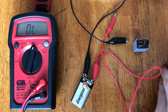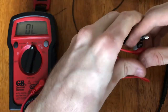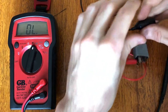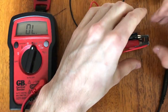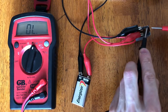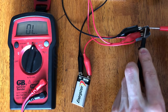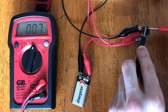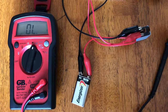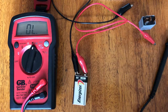There's our zero — that's perfect. Now we're going to put the electrical connection on and make sure we have the correct polarity. We'll put our prongs back on and check for the other circuit. There's zero. So both of the different circuits are in perfect working order. We have determined that our relays are in perfect working condition, so that only leaves one thing remaining — the actual wiper assembly itself.